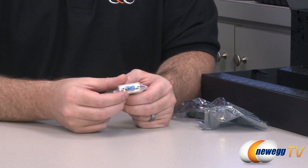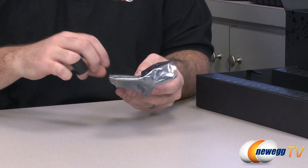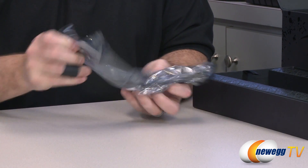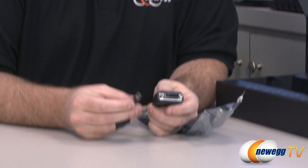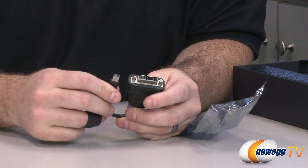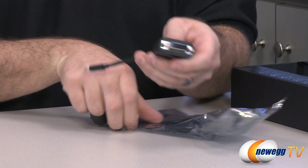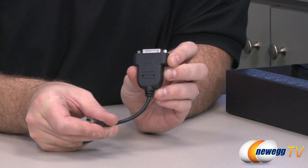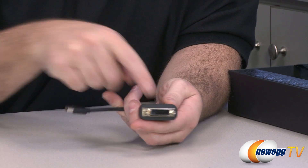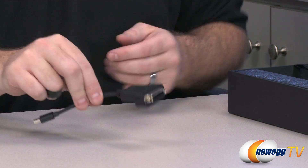You have a DVI to VGA adapter — if you're using that adapter with this video card, I'm going to personally hunt you down. Don't use a VGA adapter. There is also a DisplayPort to dual link DVI connector, which is very handy because it is an active adapter, meaning the dual link DVI via DisplayPort can handle higher resolutions such as 2560 by 1600.